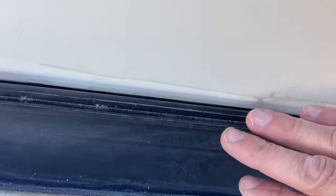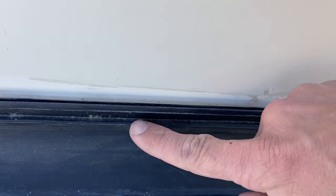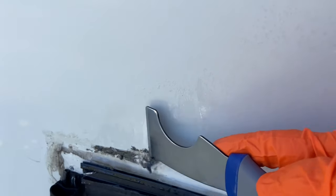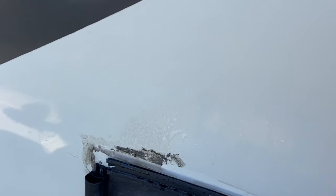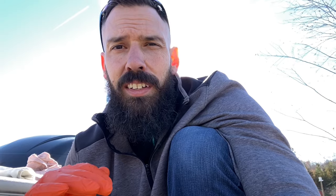As I mentioned earlier, you can see how the D-seal doesn't do much for water protection. This track that it sits on is what you actually need to make sure is sealed up good — and this one is. I like to use a metal scraper very carefully. As long as you don't dig into your camper, you're going to be fine. I also like to use a plastic scraper to clean up any of the old sealant and caulk. A lot of times I'll use WD-40 on it, and after that I'll take mineral spirits and clean it up, make sure it's all nice and dry, get the spot looking good, and then go ahead and slide the D-seal on.